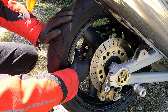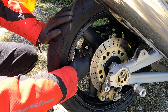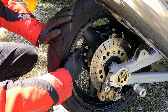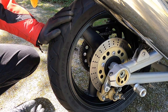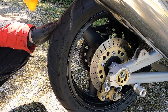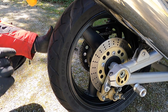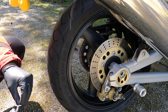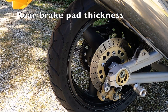Don't ever run decorative caps on your valve stems because that puts pressure on them. The one that blew out on me had a metal skull cap the previous owner had put on — the weight continually bent it over at high speed and caused it to fail. So check your valve stems every time you service a bike — it's a critical safety thing. If they go, your tire pressure drops from whatever it's set at to zero in maybe five seconds. Next thing is to check the rear brake pads.